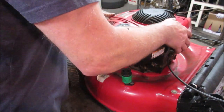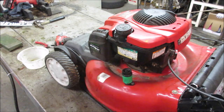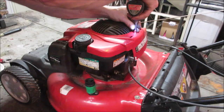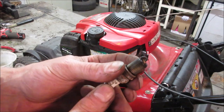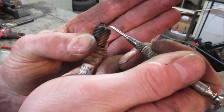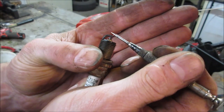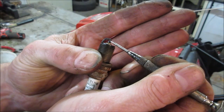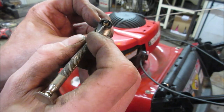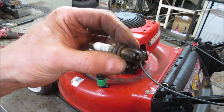I think we're good under the hood. Pop that cover back on and we're good to throw oil in it. A lot of people will automatically throw an air cleaner in it and throw a new plug in — but when you look at a plug, that surface right there will end up getting round and burned away, but this one is still flat straight across. The gap looks good — you can put a feeler gauge on it but I'd say it's fine. The other place plugs fail is when crud builds between the porcelain insulator and the outer wall and it arcs across. I don't see anything packed in there — I'll just clean it up real quick on a wire wheel and throw it back in.